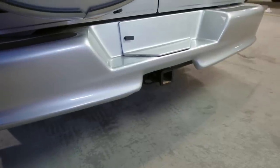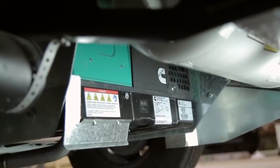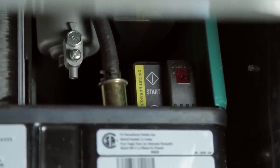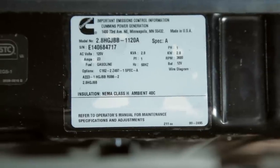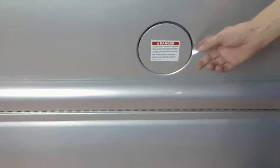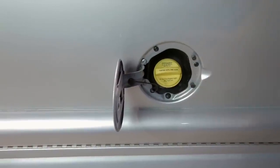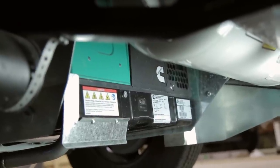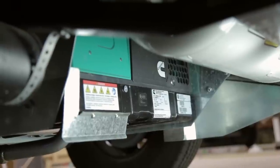The generator is located just in front of the propane tank under the rear of the vehicle. Please refer to your ONAN user's manual for operation and maintenance. The ONAN generator is a 2.8 micro light — a gasoline-powered generator fed from the main fuel tank. It will shut off when a quarter tank of fuel remains, so always check fuel level if the generator refuses to run.